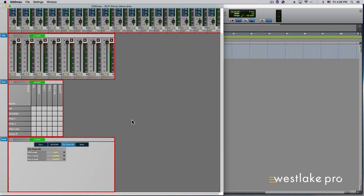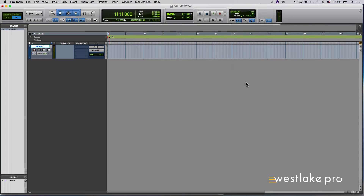This will appear in Pro Tools I/O setup as 4 different 16-channel interfaces, for a total of 64 channels. Alternatively, you can choose Primary/Expansion, which allows 2 separate Pro Tools systems to be connected, each with 32 channels of I/O. Once you have chosen how you would like Pro Tools to see the Matrix, when you open Pro Tools I/O and Hardware Setup, the Matrix should appear.